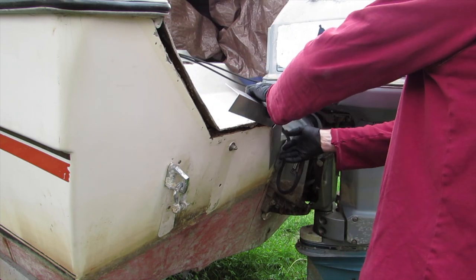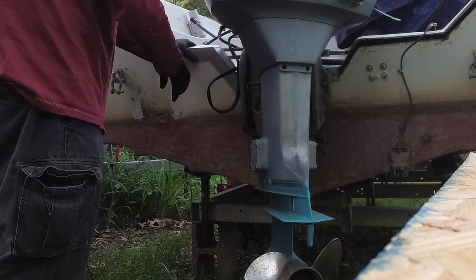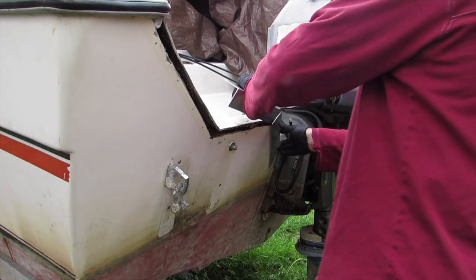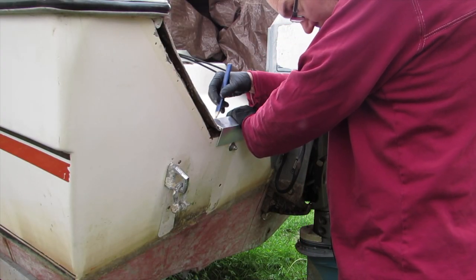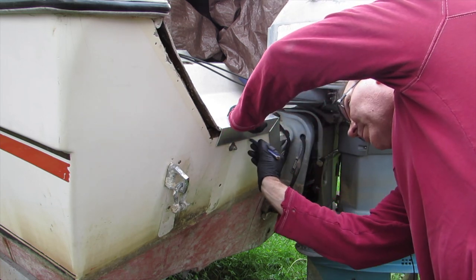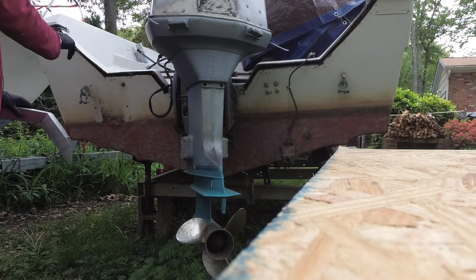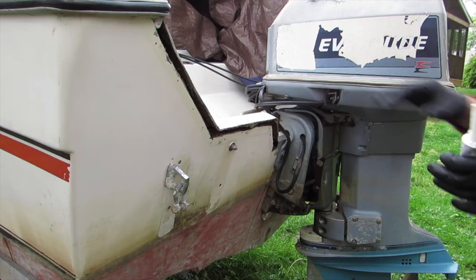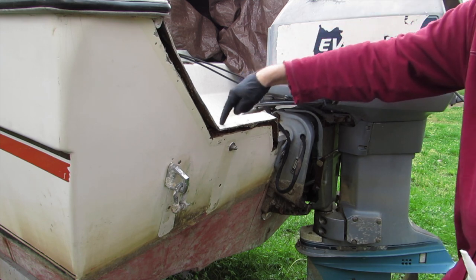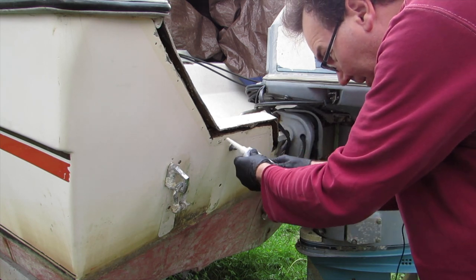The first piece I want to fit is actually one of the hardest — I have no idea how I'm going to get screws or rivets into that side right there, but this is where we're going. One of the things I decided to do was take a pencil and draw around the outside edge here so I can see how far out I can run a caulk bead. And there we go — there's where I can seal. We'll run a bead of sealer all around here, stick the piece of metal on, and then start screwing some stainless steel screws in with a little blob of sealant at each screw point. So let's just go for it.